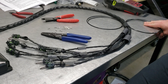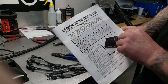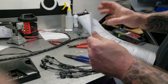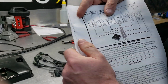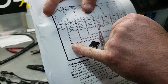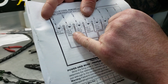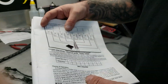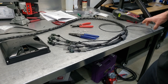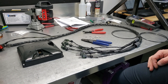Hopefully that answers some of your questions. All this stuff is shown inside the instruction manual, but I know what happens to those typically. If you look close, you'll see terminal A comes down to the brown wire, terminal B to the gray wire, terminal C to your ground. If you want to clean it up, join them all together into one wire, ground them at the back of the cylinder head, and have a nicer looking install. All right, that's all I got. See ya.